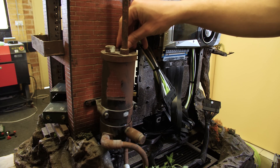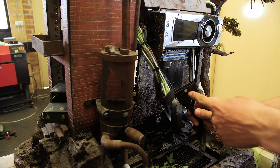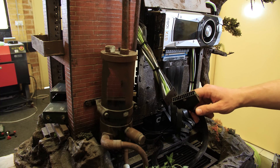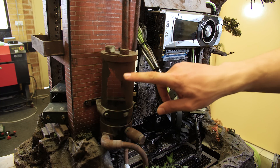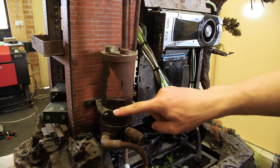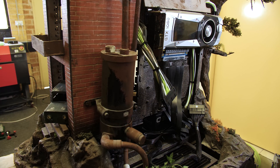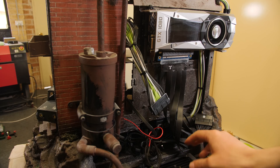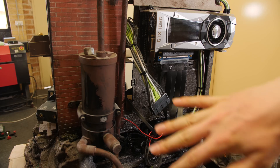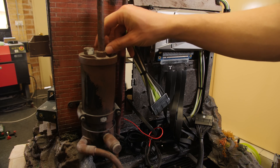Once you've filled the reservoir to the top, put the cap back on just in case — normally the water won't spurt out, but I always like taking precautions. I've got the 24-pin with a little bridging device here — it bridges the connection and allows power without actually powering the motherboard up. I'm going to switch on the power and let the water go down to about this ring here, then fill it back up and let it run through again. Now that the liquid has mixed in, you can see it has turned purple from mixing with the old coolant — we're going to drain that out and make it all clear for you so your new liquid comes out the color you want.